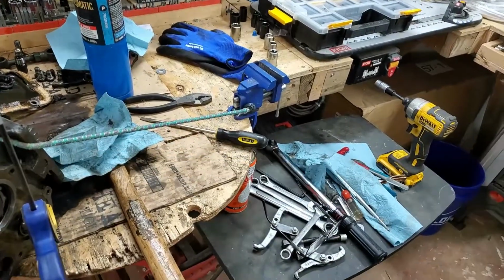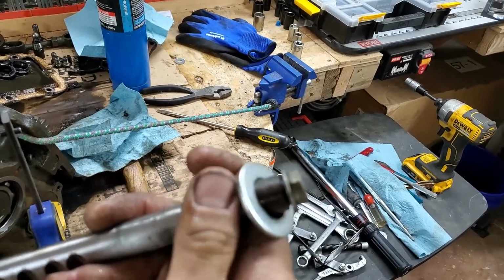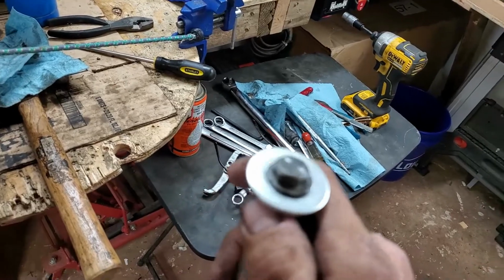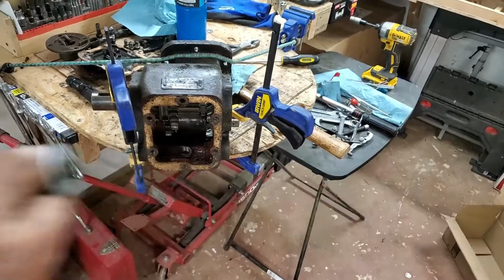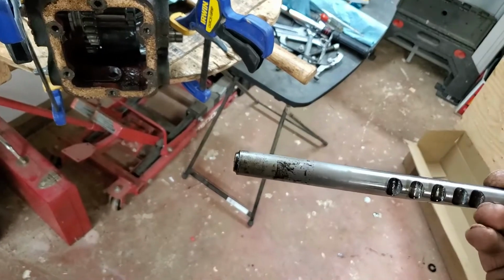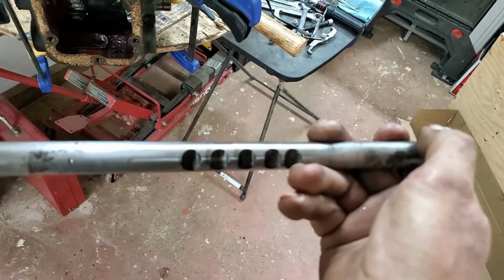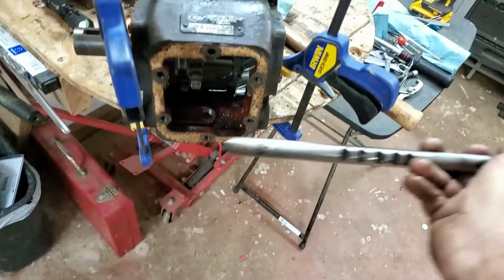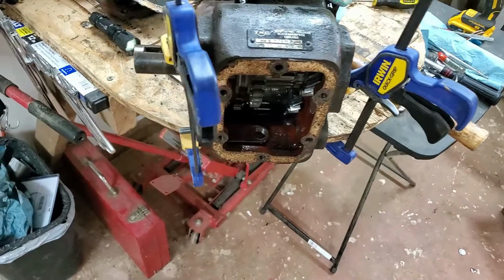But we're going to use this shaft, and my shaft already had a bolt on the end of it, a little washer, and then I added a 3/4 inch washer to keep this thing from shooting out. I did it this way the first time. Even though this is metal, if it lands wrong, or this is a concrete floor, it could theoretically bend it just enough, or maybe mess up the tip of it just enough so that it wouldn't slide in and out properly, and then of course that would wear your seals and things would go really bad.